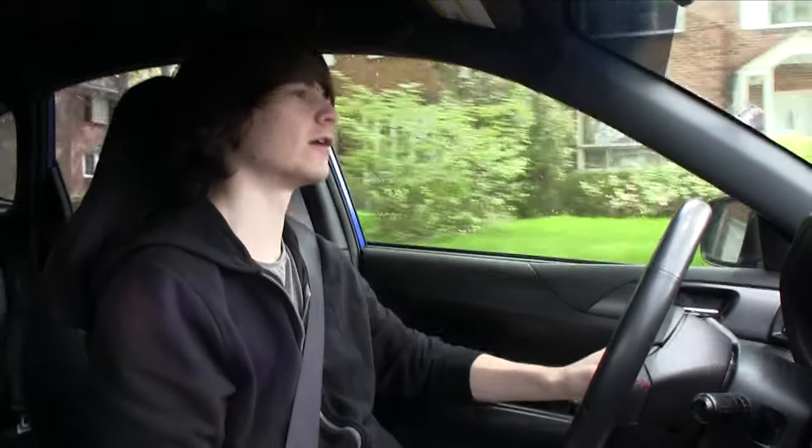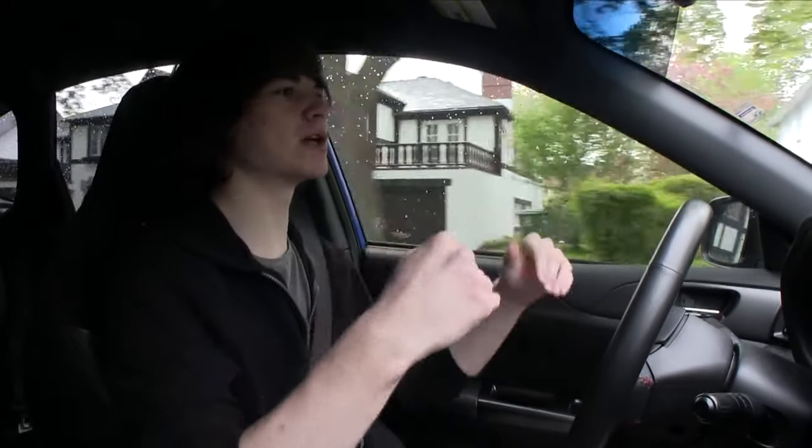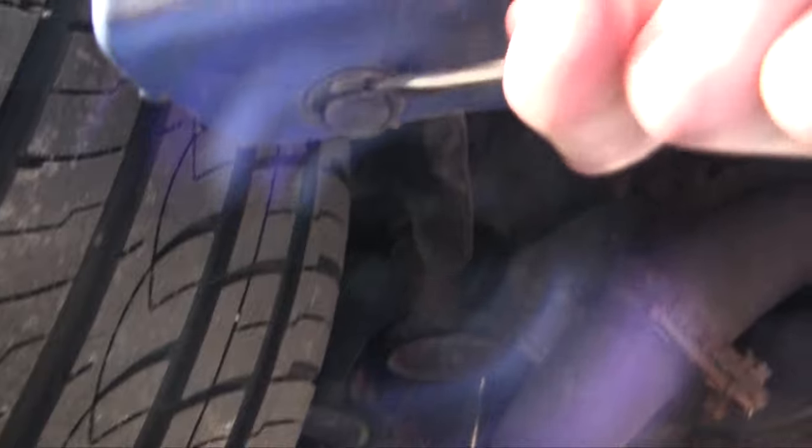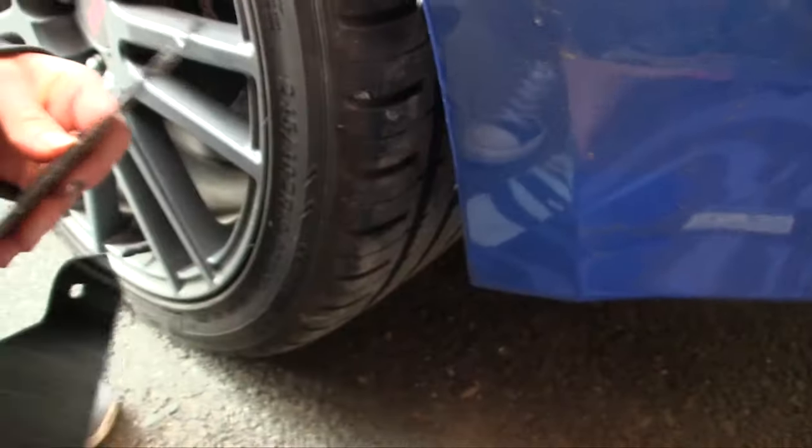You can probably get a good sense of how we did everything on video. I'm not an expert at this whatsoever, but if you pick up the mud flaps, it's very self-explanatory — they give you awesome instructions if you take the time to read them. The ones on the back are really cool because they're quite long and thick. They give the appearance that your car is much lower than it actually is, and it looks really cool. All you have to do is pop off one push-pin plastic clip from under the rear bumper. Then you'll have a metal bracket — a bit different and smaller than the front one — and you just slip that under the bumper between the bumper and fender liner so there's no metal sticking out. Then you put your mud flap on, do up the bolts, and it's very, very easy.